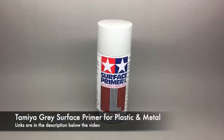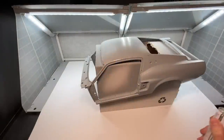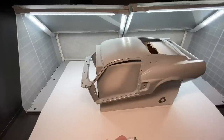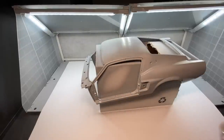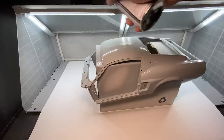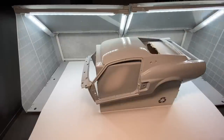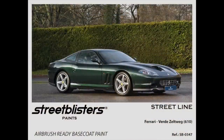Since the 600 grit still leaves a bit of a rough scratch for paint to lay on top of, I decided to go over it again with another good coat of primer. Just like the first application, the second one goes down the same way — not going for super thick coverage, just making it nice and smooth, covering all bare metal spots and filling any rougher sanding scratches. After applying this second coat of primer I let it sit and dry for about half an hour. The primer cured really nicely and left a super smooth finish, so I decided to leave it as is rather than sanding again with 3000 grit.